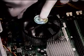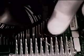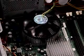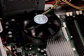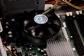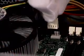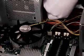To activate the four caps, press down on them with your fingertip while applying downward pressure on the heatsink to prevent it from tilting. You do not need to rotate the fasteners during installation. Check that both the fastener caps and the base are flush with the motherboard. Now connect the four pin fan header with the motherboard header, noting proper key orientation. Finally, ensure that any excess cabling does not interfere with fan operation.